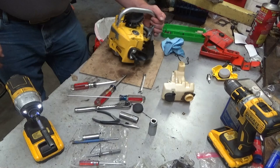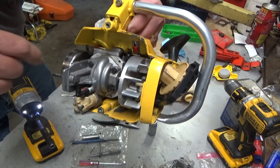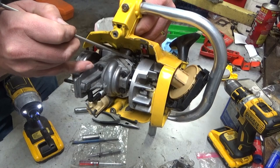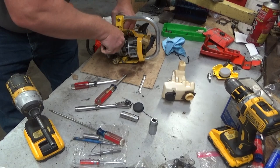there. Then you've got to reach up in here and disconnect your throttle rod. There's my pointer tool. We'll use that. So there's the rod. It just clicks into there. So you've got to hold the trigger down, basically pull it up and out. And I do that with a pair of needle nose pliers. You heard that noise? Pull the trigger back, drop the rod down.